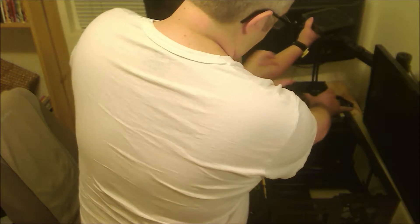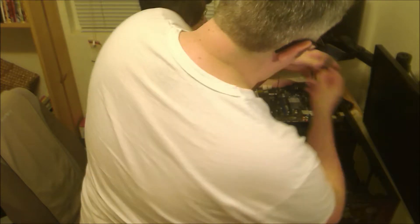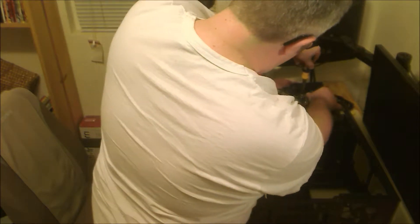Sorry folks, this is a delicate maneuver. You might not be able to see, but this is terrible. You have to be really careful. And I wish my thumb was like five inches longer. You have to do this in a cross pattern — not one after the other — because this puts the least amount of stress on the CPU, and that is the name of the game. You want to do two or three rotations, two or three threads per, and then just work your way around.